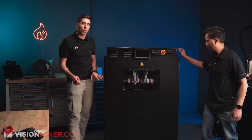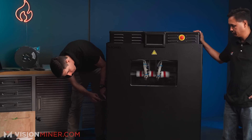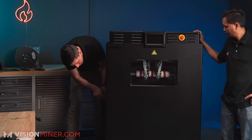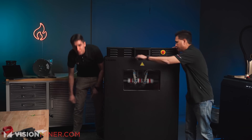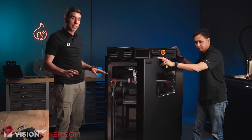To open the door when the machine doesn't have any power and you don't want to plug it in at this state, there's actually a little slot right in here. I'm going to put my hex wrench inside — boom, opens up. You just go like that and that's going to unlatch the door.